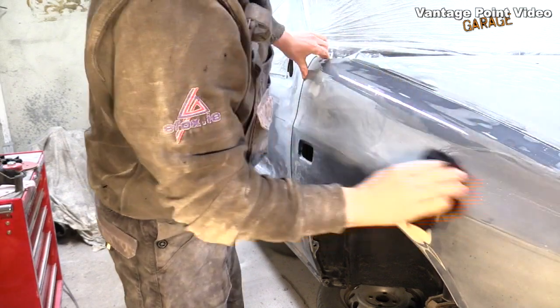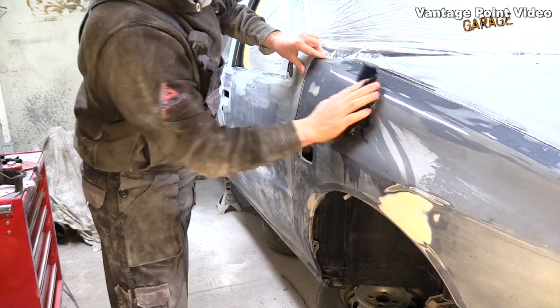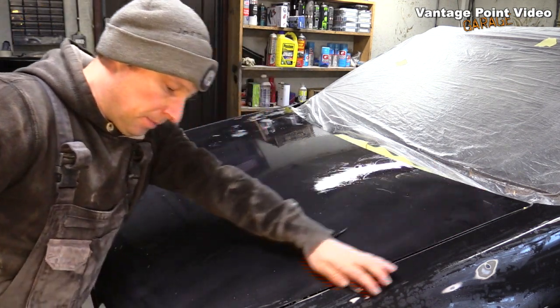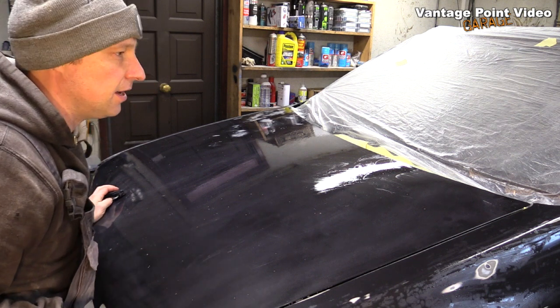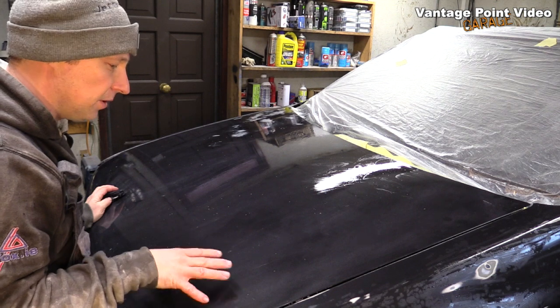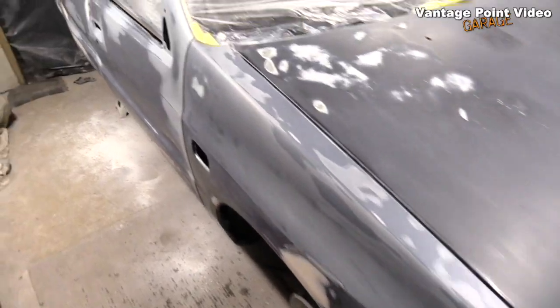I'll take a break here, which will allow me to do a little bit more touching up before starting fresh into the spray painting. So that's most of my paint prep done. I'm going to spray it in sections, and I'm going to do the doors first. So I'll probably do a few other little bits and pieces to the bonnet as I get closer to painting that, and also bits like the sills and the slam panels.